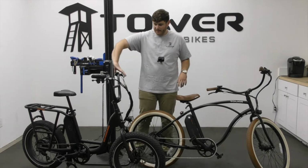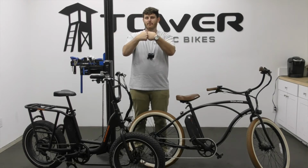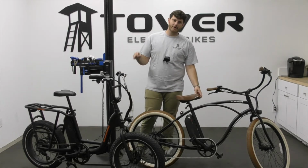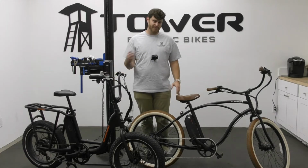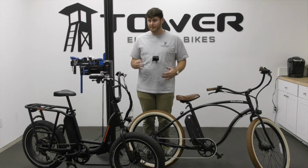With a mechanical disc brake, when you squeeze this lever, you're literally pulling a cable that's actuating a piston and pushing a brake pad into a rotor into another brake pad. Because you are literally pulling that cable, all of your brake power is reliant on your hand strength, which is fine if you're starting out the ride, but if you're riding for a long time and you've got some long breaks, towards the end of the ride, your hands might be very tired and you may not be getting the same braking power.